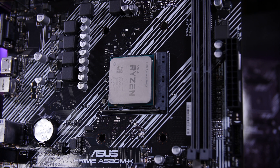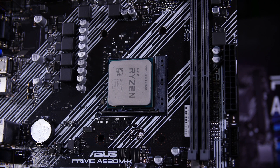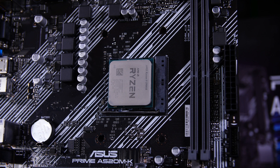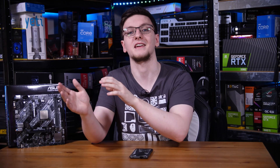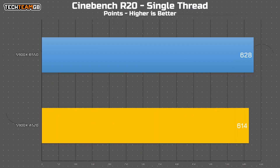The tests I ran weren't just to see how quickly this thing would catch fire, but my full suite of CPU benchmarks to see how much performance you lose using a relatively low-end motherboard with a relatively high-end chip. The A520 board offered around 2% less performance in Cinebench R20 single-threaded — actually quite surprising, since single-threaded workloads generally don't draw much power, but in this case, not quite.